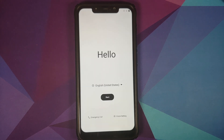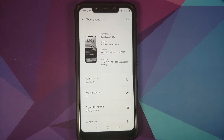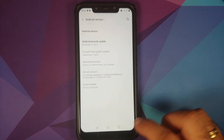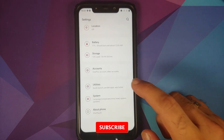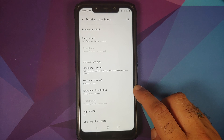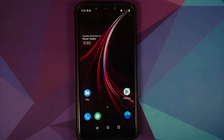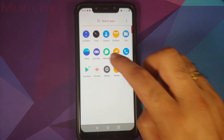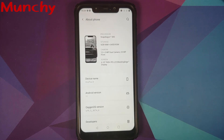We're on the initial setup screen — let me skip through that quickly. And there it is, we're on the home screen. Going into Settings > About Phone, there it is: OxygenOS 11 based on Android 11 running on the Xiaomi Poco F1. We can also verify encryption by going into Settings > Security and Lock Screen > Encryption and Credentials — 'phone not encrypted.' No need to flash disable-force-encryption explicitly. That's how you install OxygenOS 11 on your Poco F1 — hope this video helped, likes, shares, and subscribes are appreciated!